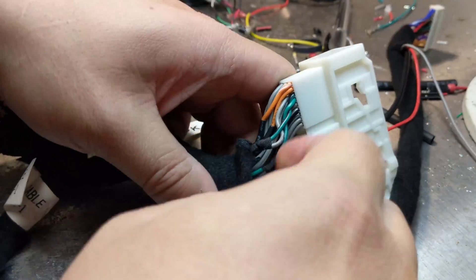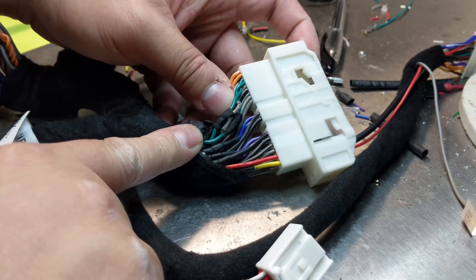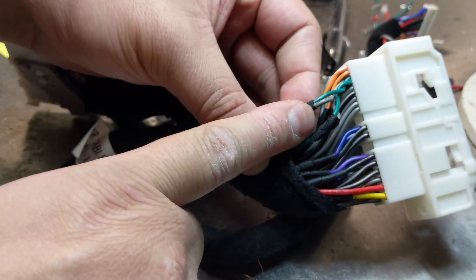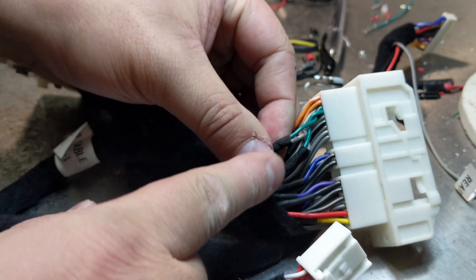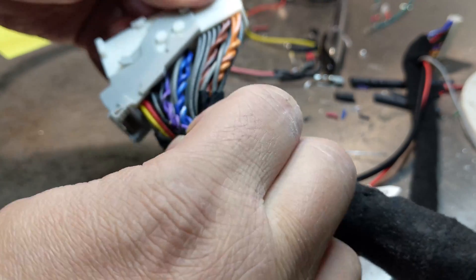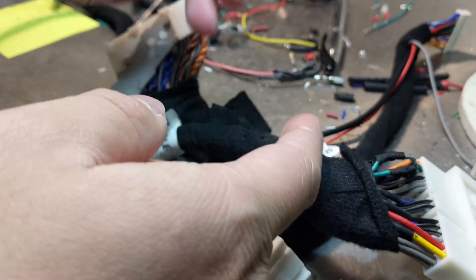Working with their support, I think we figured out what's going on. There was a little miscommunication because they speak Chinese and their English wasn't great. They sent me a picture — there are two sets of wires. Those two gray wires are hooked up to the two green wires, which are for the remote mouse. They twisted another pair of wires next to it and spliced into it, and cut that on the other side too. They want me to cut the gray on both sides and hook them back up together — that should fix it.